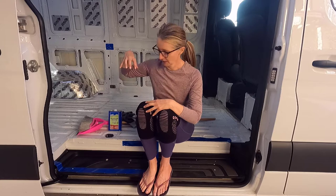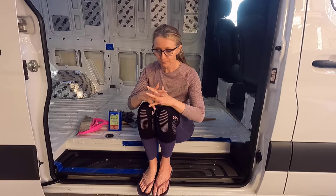A few things to think about when preparing your subfloor is what's going to require holes basically — your outlet for your greywater if you have undermounted greywater, inlets for propane if you're going to undermount your propane tank, and positions for your diesel heater or propane heater where you'll need to drill holes in the van for the gas or diesel to come in and out, or the exhaust in the case of a diesel heater. Think about those things because I'm going to frame around them — I've already had a good look underneath and know where they need to go.